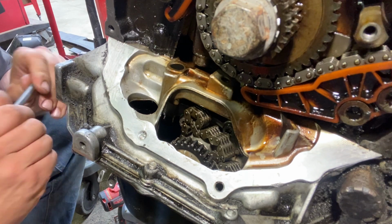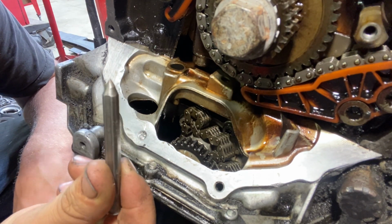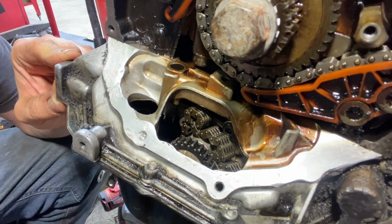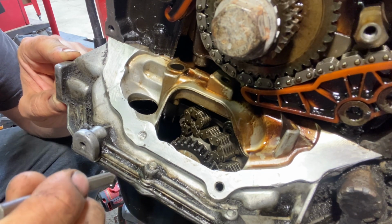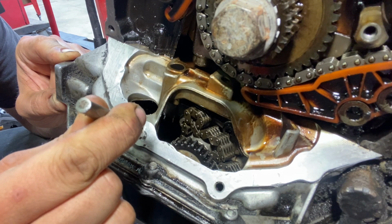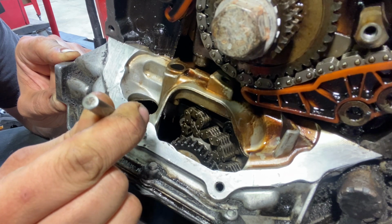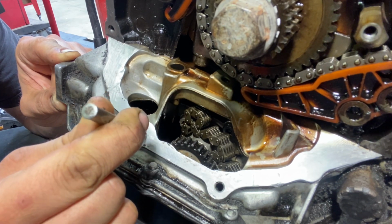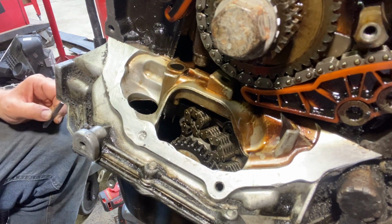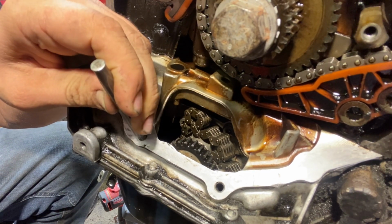The most important part of this job now is getting the hole centered. So what you want is a really sharp center punch. I probably have one somewhere. I need to order at least one more. There's a self-centering punch, a center punch that has a little spring loaded action in it, and you push it down and it is a self loading punch. So you don't have to pull a hammer with you and do it. I don't necessarily need that for most applications. That's kind of a precision application.